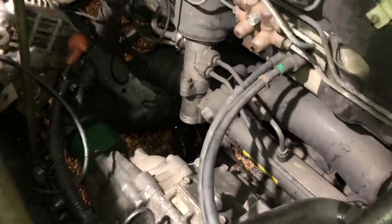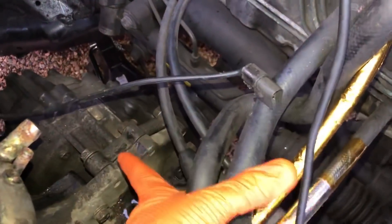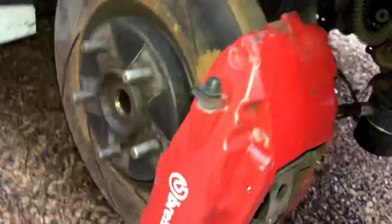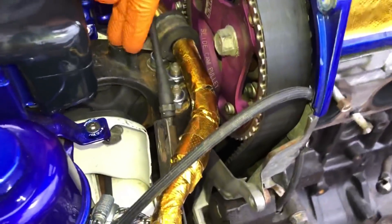I'm going to get this wiring sorted, take the alternator off to make things a bit easier, then get around to popping the drive shafts out. First off you've got to take the ball joints. Really all that's left to do now is take the transfer case off the back and take the prop shaft. I've already started loosening off these bolts - three at the top and three at the bottom. I've already took out the driver's side shaft, so now I'm going to take out the passenger shaft and then the intermediate shaft under the oil cooler.